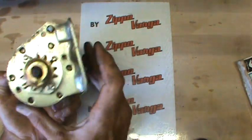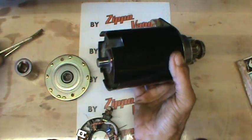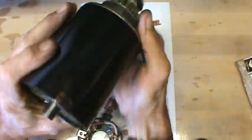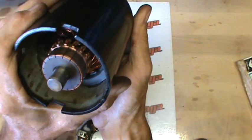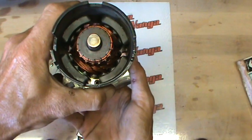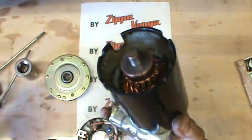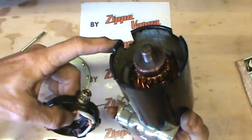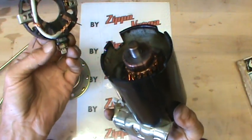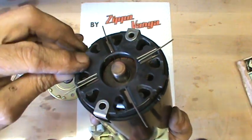You've got your screw hole here and a screw hole here, and your bolts that hold everything together go through the entire frame. You can just eyeball it for the moment. You can see the daylight there — that's got it close, and that's good enough. Now take your brush plate, and be sure to orient it correctly. You've got a deep well here — that's where your starter wire connector goes. Just take it and set it down on there.